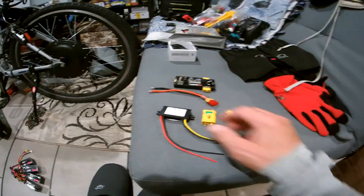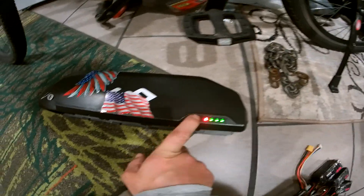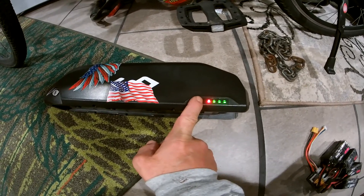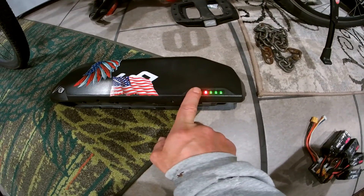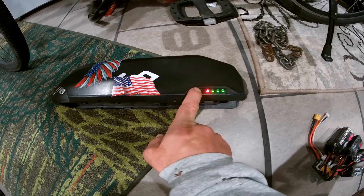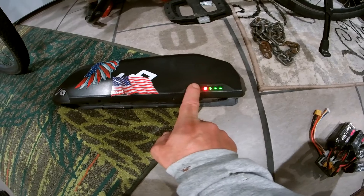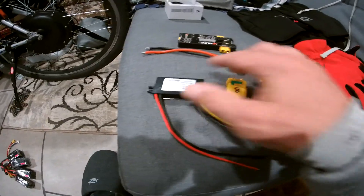Just a quick show of what I got here. Don't go by these gauges they put on here — I got 54 volts and it's still showing full, but it's low. Maybe if it's for 52 volts it starts going down, but I haven't gotten it below 52. I never go by that; I check it with the meter all the time to make sure.